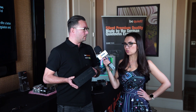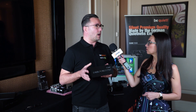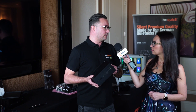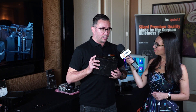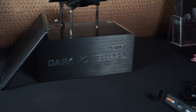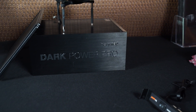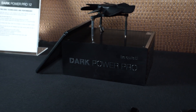For people unfamiliar with PSU technology, what kind of benefits would an all-digital PSU give to a consumer? You basically get much tighter values on all the parts and circuits. You also get a lot of benefits on the inside of the power supply in terms of design — we're able to do a power supply that almost has no wires anymore on the inside. There are only two wires connected to the AC elements; the rest is completely wire-free, which gives you great airflow. Even an 80 Plus Titanium supply doesn't run that hot anyway, so that's already a benefit.